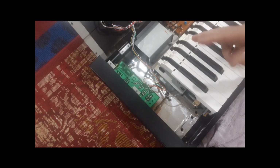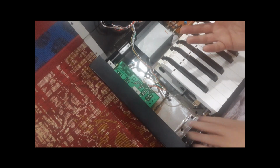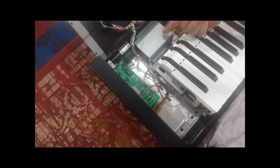The thing about that is, electronic circuits are very sensitive to static electricity. Even right now, there's probably a couple hundred volts on my body until I ground it. You can't feel a zap of 100 volts when you touch ground. It's thousands of volts when you get that little spark, when someone hits you behind the ear with static walking across the carpet.